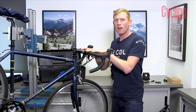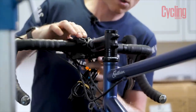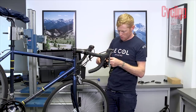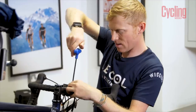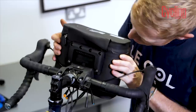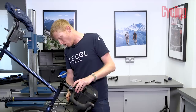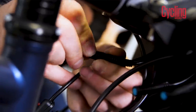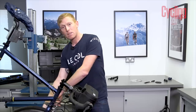The front wheel's in. Now we need to put the bracket on the handlebars — this will be the bracket that holds the control unit and the battery. It should be really simple: this strap here goes underneath the stem to stop it from rotating around, and there are some smaller handlebar adapters if you have smaller handlebars. Just put the battery pack on the handlebar bracket so it's nice and solid — we can adjust the angle in a bit anyway. At the back of the adapter there are a few different sockets; the thickest one is the main power cable that will go down to the hub, so connect that first and position it so it's not in the way.